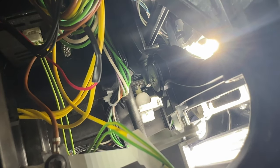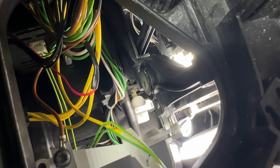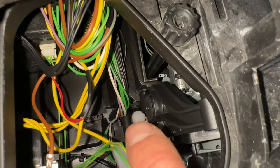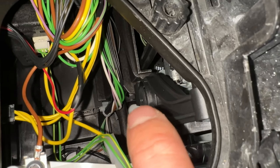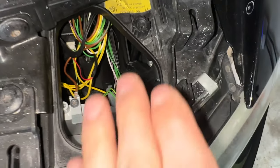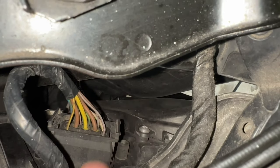If it is broken, I'll probably have to take the headlight apart or replace it entirely. I tried getting my hands in there to adjust this plastic piece and get it on top of the adjuster — the adjusters handle both dynamic leveling and left-right steering movement. But from the front there's just not enough access, so I'm going to remove the cover in the back to get full access.